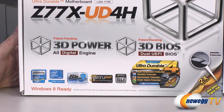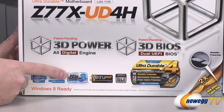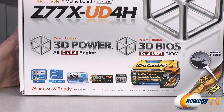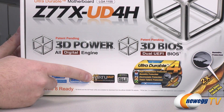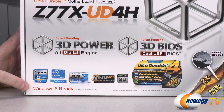As mentioned, second or third generation core processors from Intel, Z77 chipset, PCI Express Gen 3 support if you go with an Ivy Bridge processor. You get Virtu MVP, which is a software solution that will allow you to virtualize your GPU — so basically if you go with the integrated GPU in your Intel core processor and you have a discrete GPU, you can use Virtu MVP to switch back and forth to take advantage of things like Quick Sync, which the iGPU in Intel core processors is very good at for video encoding.